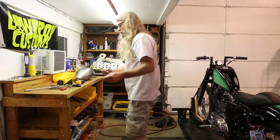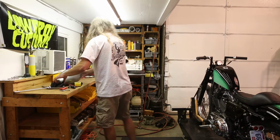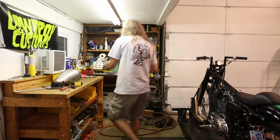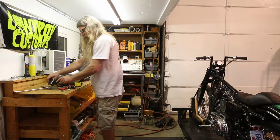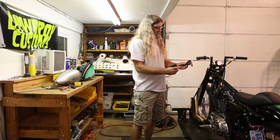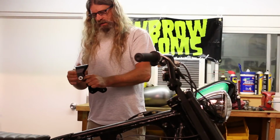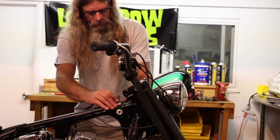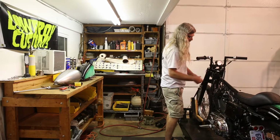Okay, so we've got the 2 bolts removed. Just going to pop this tank off of here. These brackets are pretty easily identifiable. The rear one will have 2 different mounting locations to allow you to put different tanks on there, and the front one just has 1 hole. These are 3/8-16 fasteners. This one's going to go on like so, with the larger portion facing rear.